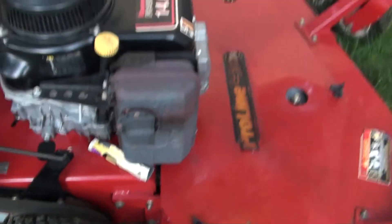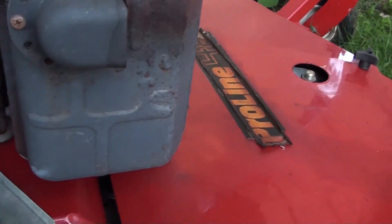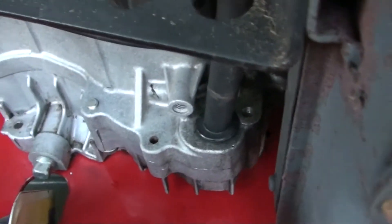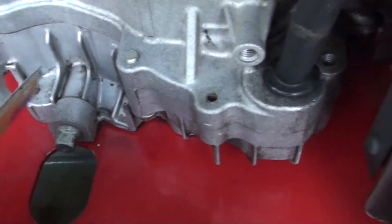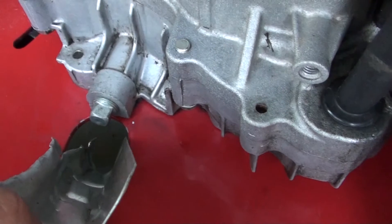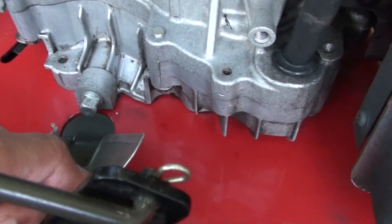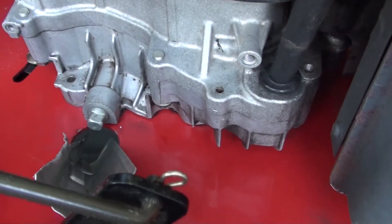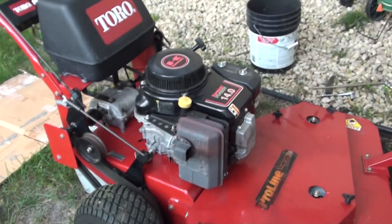So that's the whole idea. If you create a little deflector, that should minimize the mess — it will also direct the oil directly into the pan below. You can kind of see the position of the pan and where the edge is. You can actually direct this right into the pan in the back and not have anything fall into the foil, though you'll probably get some oil in the foil anyway. That's basically how you minimize the oil mess on a commercial mower, and I think you can apply this to many different mowers.